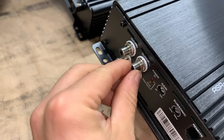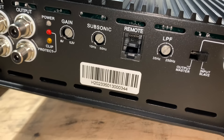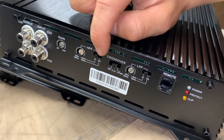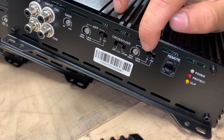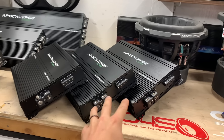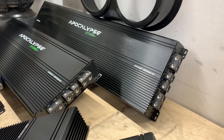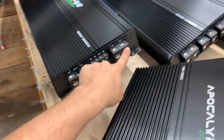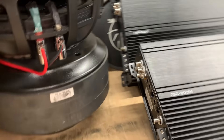They all have the really nice Tiffany-style connectors. The 1-channel amps do have master and slave modes. We also have gain, subsonic, and low-pass filter. On all of the 1-channels, there's no bass boost because we don't need it. On the 2-channels, we've got gain, high-pass filter, and you can go between 1x and 10x, with crossover options for high-pass, flat, and low-pass — so you can use these for your bass as well. There's also power protect and clip lights. The 2-channel amps all have just one pair of inputs. The 1-channel 4K has two pairs, and the 6K and 8K have three pairs. The 4K has the outputs on the same side as the inputs — same as the 2-channels — but the 6K and 8K have the outputs on the opposite side.